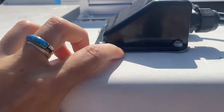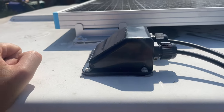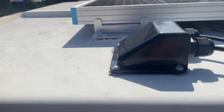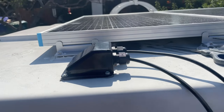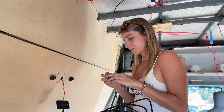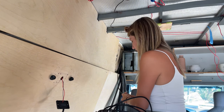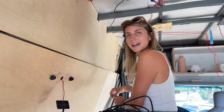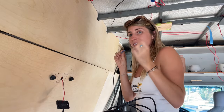The housing is secure. We have butyl tape down the bottom and we've put self-tapping wood-to-metal screws in. These screws are technically not necessary but we do it to be safe — better safe than sorry. Then we will silicone around, just like I siliconed the feet. We're pulling these cables through down into the van. Ideally, use red tape to mark the positive, but I can only find blue so let's not forget. We're not going to need all of this cable, so I'll mark it in the middle. In our last build we reused a lot of this 6 AWG cable for things like our bus bars and fuse box — save what you don't need because this stuff is expensive.